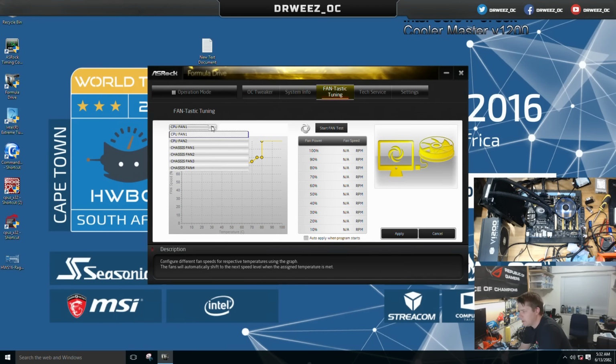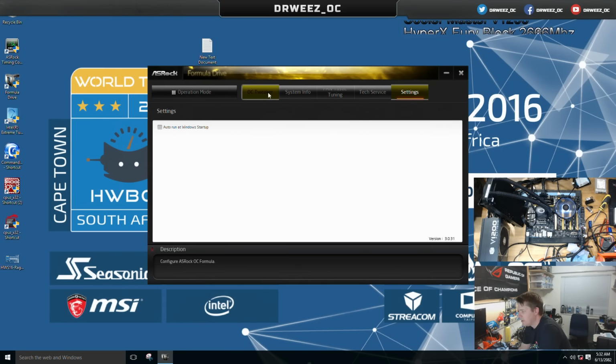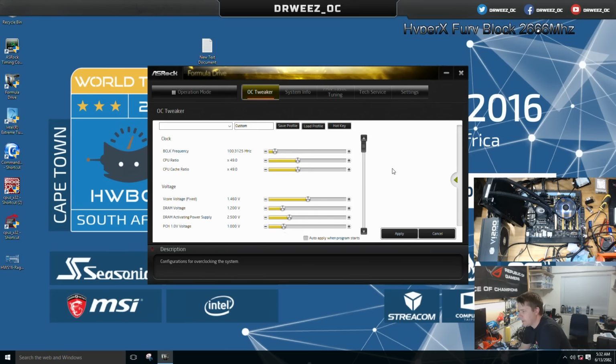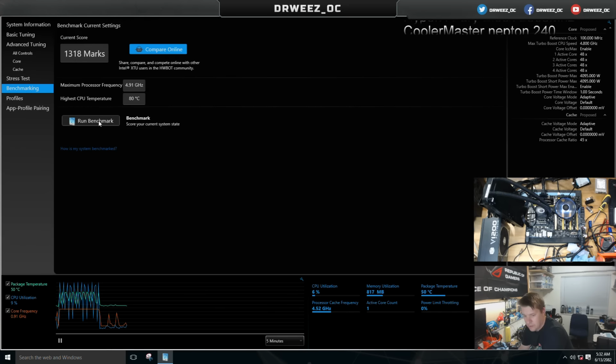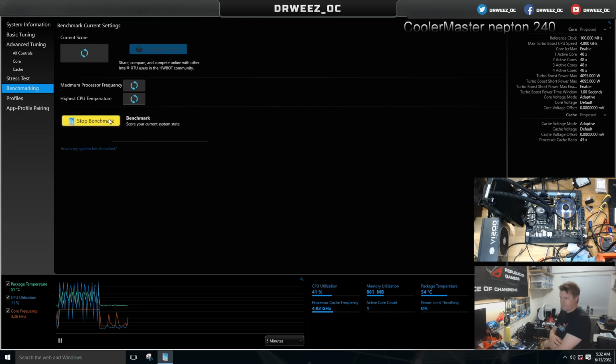How do I tune the fans? I wonder if I can. I need to just remember to go into BIOS and set the fans onto full. Something I haven't done yet. Okay. So the minute I put the cache frequency on 4.9, I get an instant freeze. So that's not gonna gel.